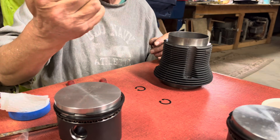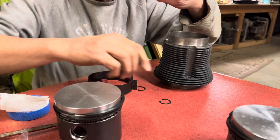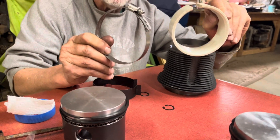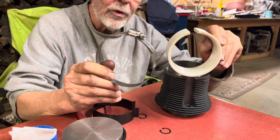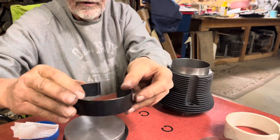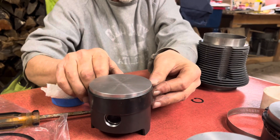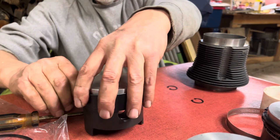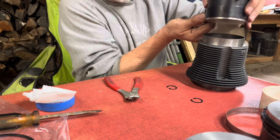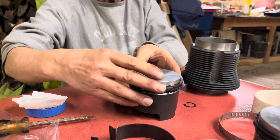There's a cheap one you can buy, and there's one made out of a piece of PVC pipe with a clamp — so you don't have to buy the most expensive tools. Put it around your piston, then take a pair of pliers, maybe vise grips, and that compresses the rings so you can slip it into your cylinder.